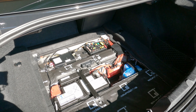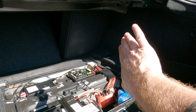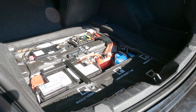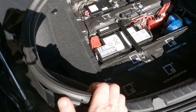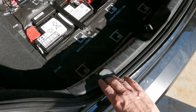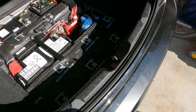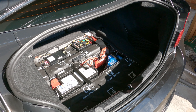One last look before we finalize and button it up. One quick hint: when you put the carpet on, tip the far end in first so it gets under the bolster, then it lays back into place really nicely. Don't forget to bring the gaskets and seals up and over the top of the carpet. When you put the plastic back here as well, make sure that you pull the rubber gasket out so it lays on top — if not, you'll have a gap. With that said, you should be all done — go ahead and button up and put your tools away.